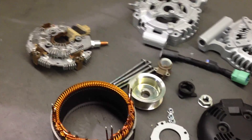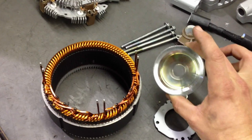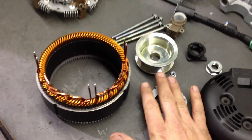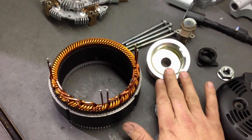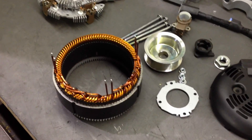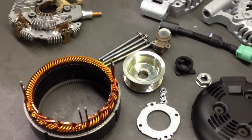But the performance on this unit is going to be a lot better, especially at idle. On Steve's unit we're actually going to be using an OEM diameter pulley because he does hot rod that vehicle somewhat. That's important to take into consideration — your pulley ratio. If we were to run a really small pulley to maximize idle output, he could actually spin the alternator too fast when the engine is at redline, which could actually damage the alternator. So we're going to use a stock pulley ratio.